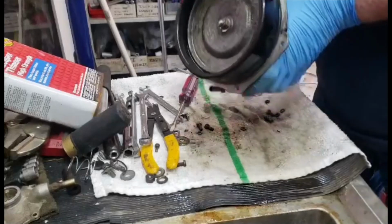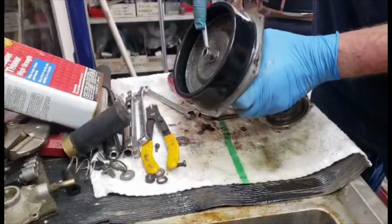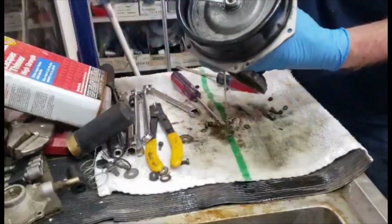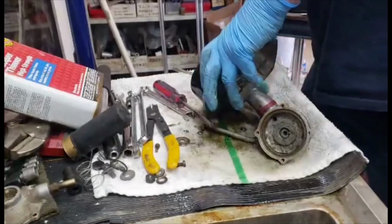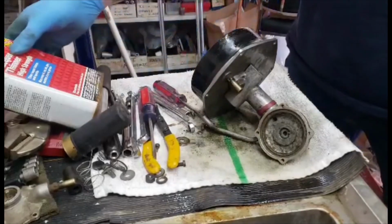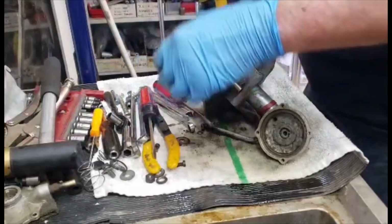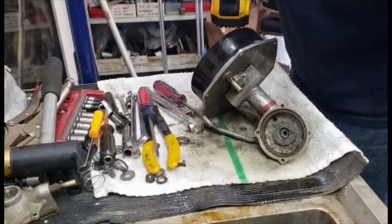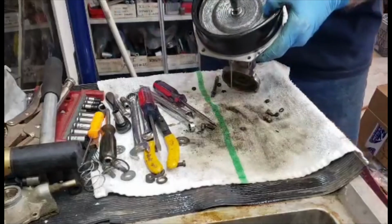It's a 10 in the center of the rubber, holding it to the piston. I'm going to take that off. You see that it's disconnected. Even though this had fluid in it and all that, and the vacuum piston's just disconnected, it was still working good. You just couldn't tell. I'm going to do this with a 10 because, let's see here. Spinning around in circles, so it's being a pain.